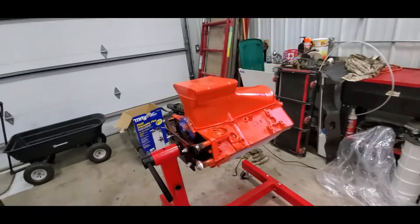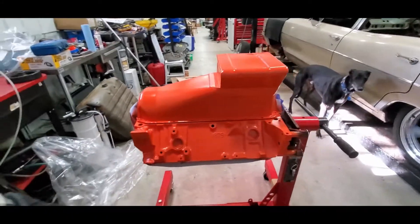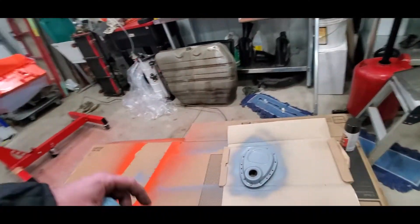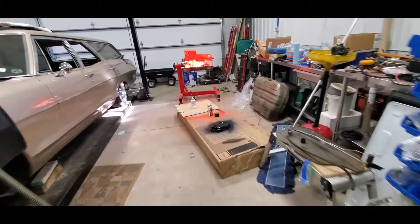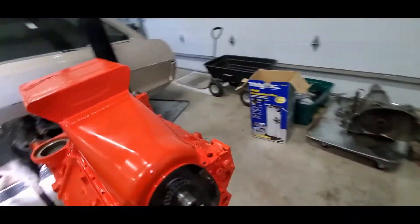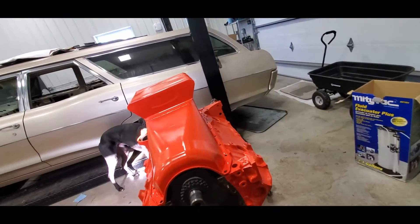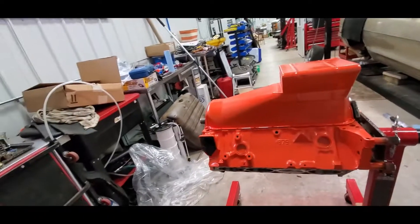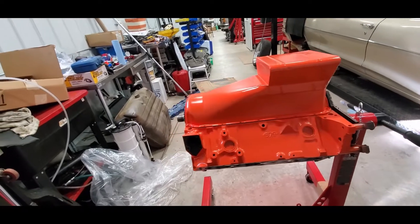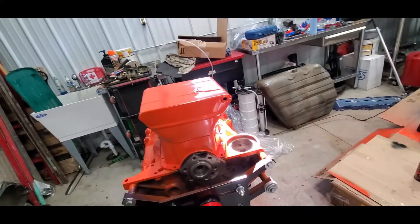Set her up on the engine for the last coat of paint on the oil pan, just to make sure we got every angle. It's going to be a nice orange engine with black intake, black timing cover, black valve covers, aluminum heads — it's going to look really nice. While waiting on paint to dry, I went ahead and ordered pretty much everything left I need on this build: oil pan gasket, valve cover gaskets, timing cover gaskets, a new block-off plate, all the little things you need, and a new degreed balancer. I could reuse that factory-style balancer they had, but I just don't trust them. Ninety dollars to know that it's correct and the balance is right seems pretty worthwhile at this point.